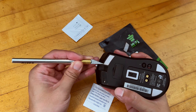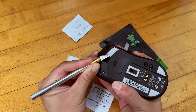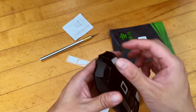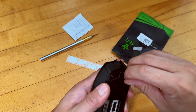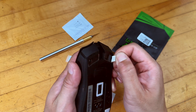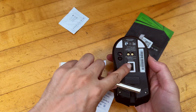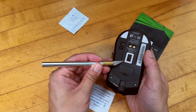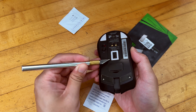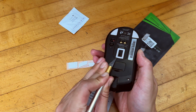You want to make sure this area is as clean as possible, and we have quite a few to do. The X-Acto knife is usually the best way for the initial prying, and it's very easy. Once you get the first part pried, you can just pop everything open and lift everything up. The good thing is the old glue doesn't really stick to the bottom, so it's quite easy to clean. This is the area that's affected the most under my heavy use, so all I'm doing is just trying to lift all parts of this old Teflon up so we can replace it with the new one.